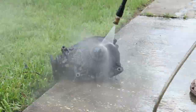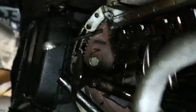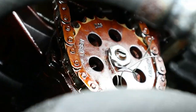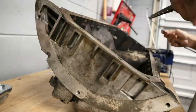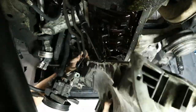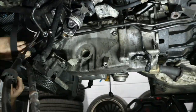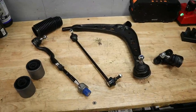After we cleaned everything as thoroughly as possible, it was time to do the best mod you have to do on your M54 motor: the oil pump nut. You want to get one that has a safety wire, just like this, because it's so common for this nut to back out on its own — your car would lose oil pressure and completely destroy the motor. So while we had the oil pan off, it was definitely time to do that. Then we started reassembling everything and getting it ready to get back on the road, all with new parts.